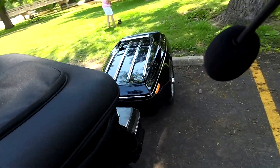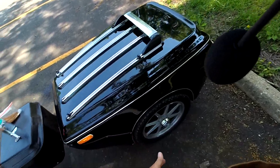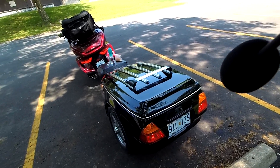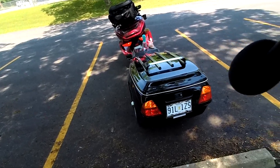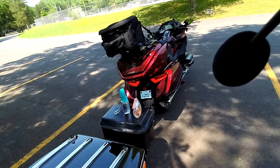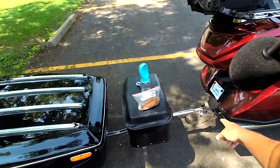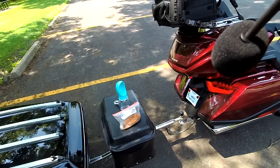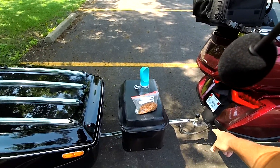The person who had it before had it wired wrong — the brake and the tail light were both hooked together. So I rewired it. Showing it with the flashers on, you can see the tail lights work good. I got a control module under the seat to run it, then I hooked it up to the connector, rewired it all, and got the hitch pin on there.